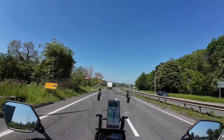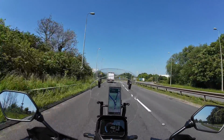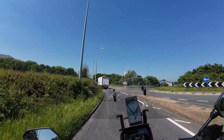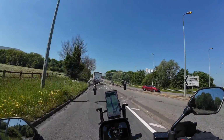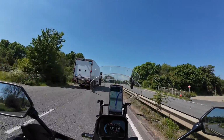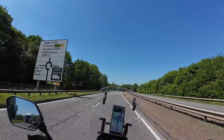Because this is not a full system and therefore doesn't remove the main catalytic converter, it still does sound a little bit muffled, and I bet this bike would sound fantastic with a proper decat link pipe, but it's important for me to be able to quickly make it quiet when I need it to be, so that's not on the cards for this bike. And for me, with the baffle out, it's the right compromise of extra bark and bass without too much extra volume on a touring bike.